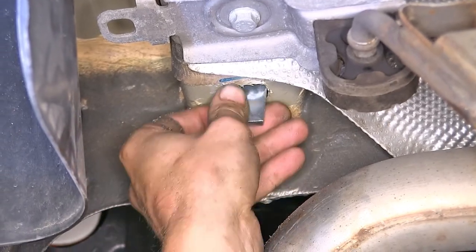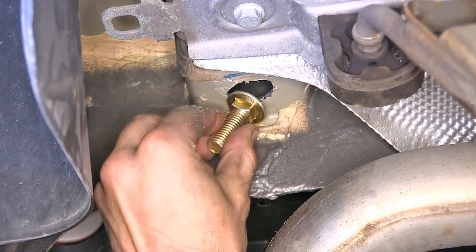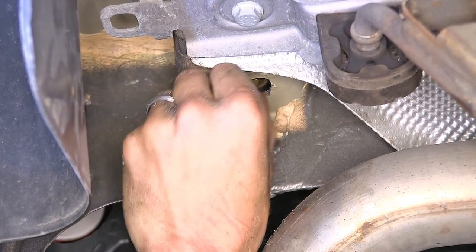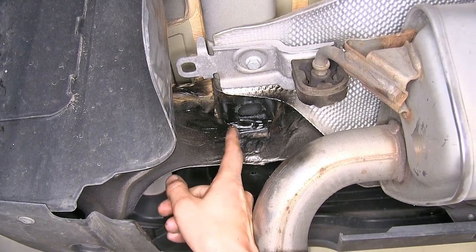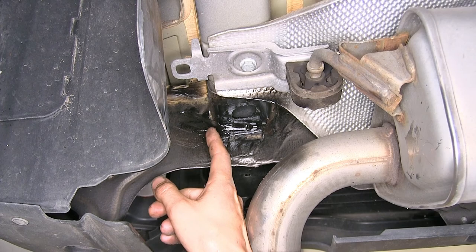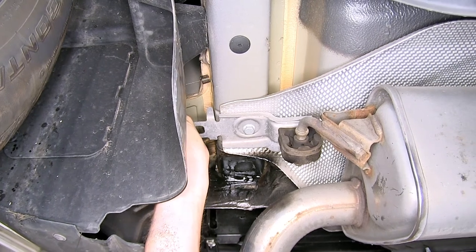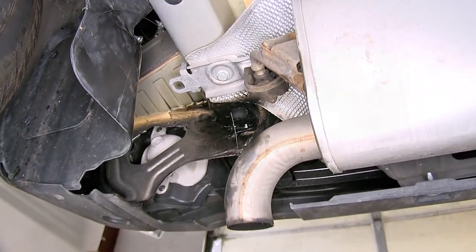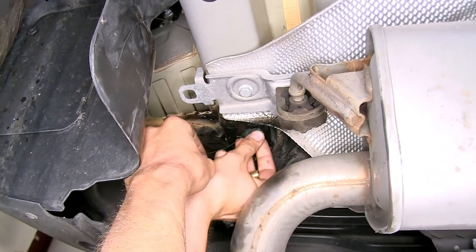Our spacer block fits in nice and smoothly. Now we'll make sure the back of our carriage bolt does as well — it goes in and out nice and smooth. Here's a tech tip: after you enlarge your hole, take some spray paint and spray paint around the exposed metal edges where you've ground it down. This will prevent it from rusting in the future. We've already gone ahead and done that. Now we'll take our pull wire and insert it in the hole in the side of the frame rail first, and it'll come out our access hole that we enlarged. We'll take our spacer plate, stick it on the pull wire, stick it inside the frame rail, thread on our carriage bolt, and insert that inside the frame rail.